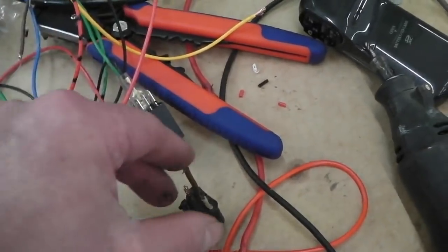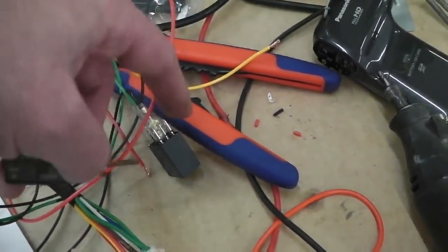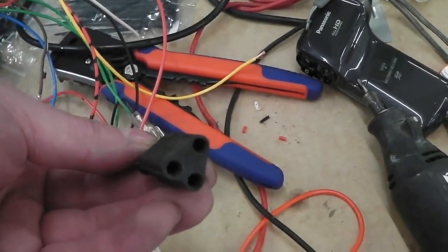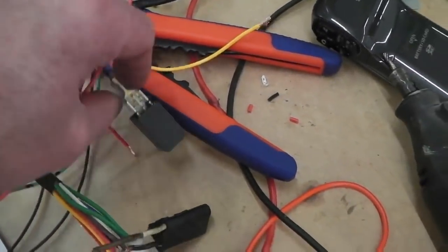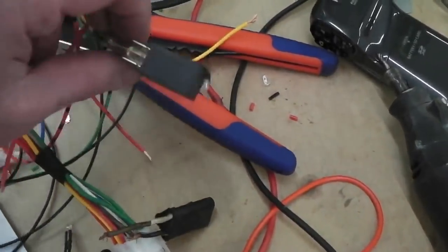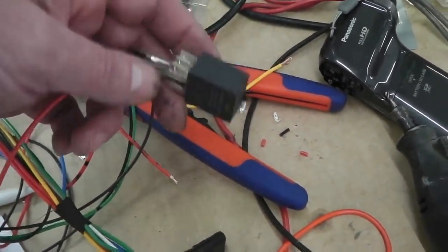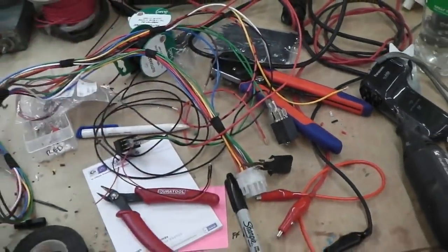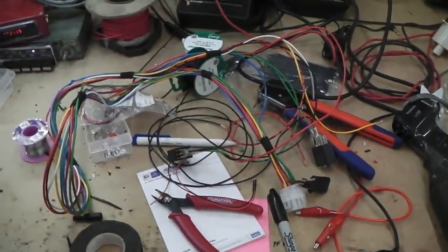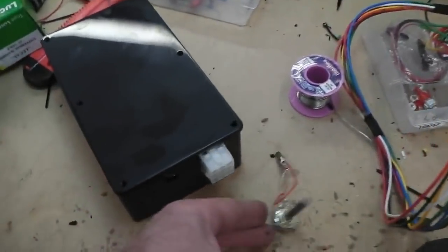Those three cables wouldn't actually connect to this, but the three cables coming out of the harness of the car would hook across these three pins of this relay, and this would then simulate my foot pressing the switch. The relay is just a slave. So that would complete it. I'll wrap this and we'll have a clean up, and then we'll summarise how far we got with the module. But it is all done.